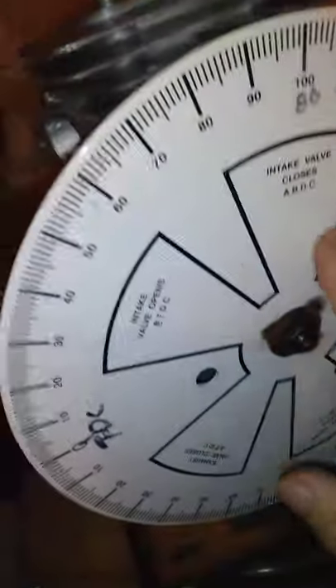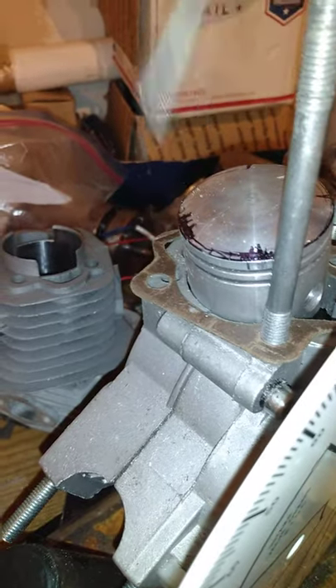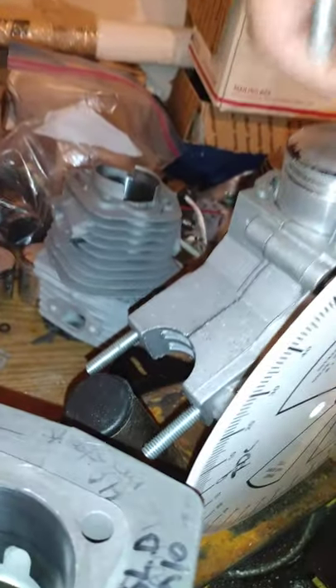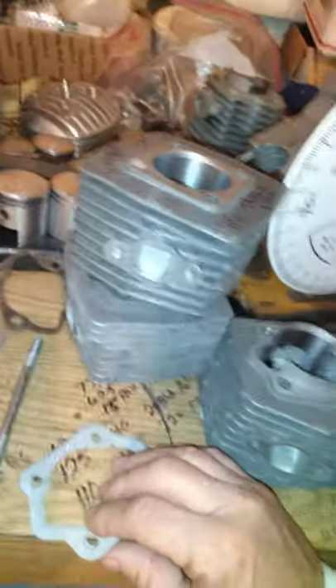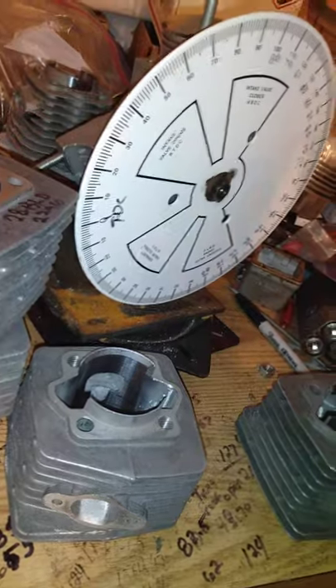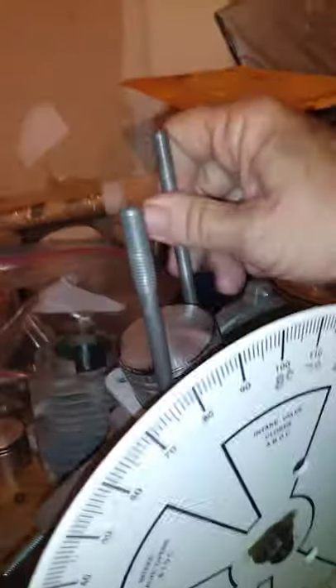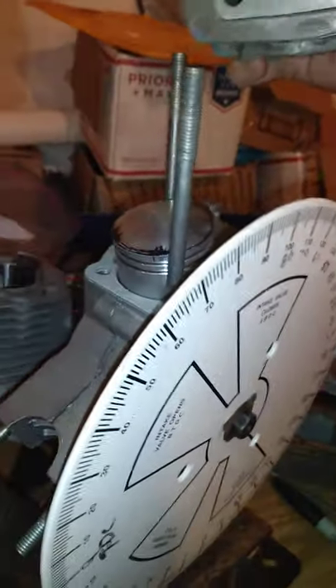I want to set my port timings first. Since this piston protrudes, it's pretty simple. You've got to keep in mind you're starting out with a stock base gasket, so whatever the thickness is, you do some simple math — this ain't rocket science. The stock G4 cylinder is at 110 on the leading one. I don't stagger stuff. The better option, if you can surface a cylinder, is to set your transfer duration without grinding if possible. I simply stack the appropriate size gaskets.